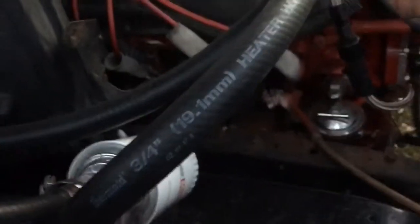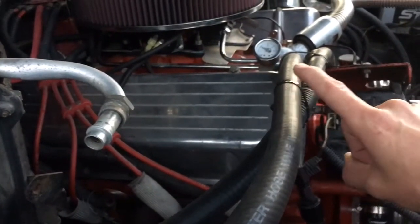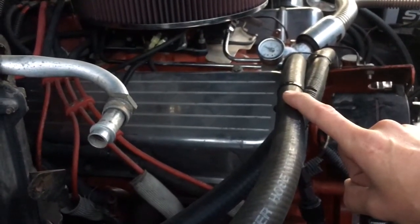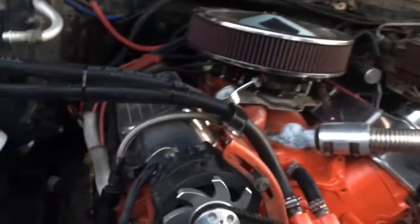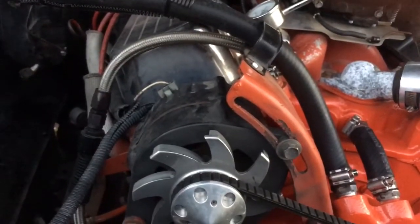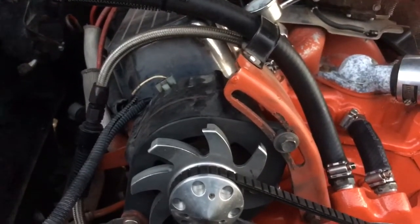What I did was finally figure out that the water line that comes from the manifold is your feed to your heater core. So I took this line from the manifold to my inlet, out of the filter to my heater core, and then back to the water pump. That made the system work exactly like it's supposed to. I had no problems with it warming up, I got heat inside my heater core — and that was how I had messed up.